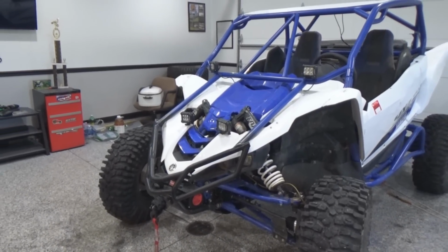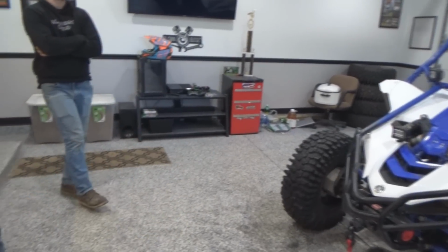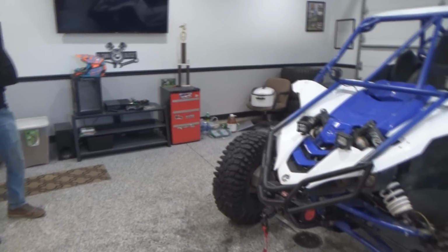But the downside to having it lifted up the way it was, with the same ride height and the same suspension tune that he was running on the 30-inch Roxxzillas, it almost wanted to just roll backwards. Yep, the front end, you could just tell. The center of gravity just wasn't ideal anymore. It just wanted a wheelie, which is weird. Take that from somebody who knows all about rolling backwards. Wheelies are my thing. But Josh tried that same climb and he barely made it anywhere up it, and the thing just straight up wanted to roll backwards. On the V-notch, it wanted to roll backwards.